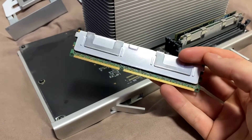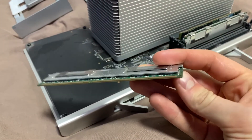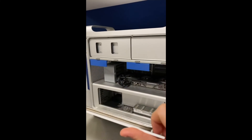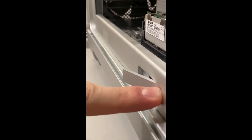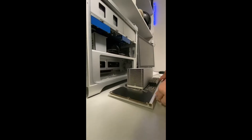Next on the upgrade list: RAM. I got three 16GB sticks of HP 1333MHz ECC memory, which gave me 48GB of RAM running at triple channel speeds — that's the best thing to do to maximise your memory speed. Depending on your workflow, you may benefit from more memory instead of the speed, but I'm okay with just 48GB.